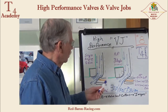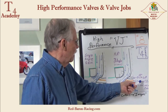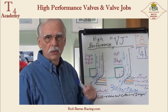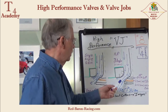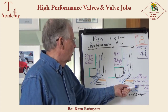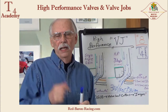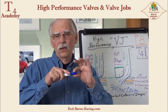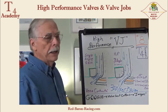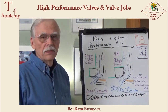On these contact areas, just a quick note. Intakes: one and a half millimeters wide — this is the target zone for most headmasters, people that do head work for a living. From the exhaust side: two to two and a half millimeters wide, and that's for the larger footprint and larger heat path to cool the exhaust valve. That's basically what a high performance valve job looks like.